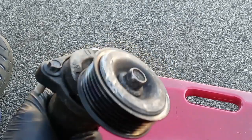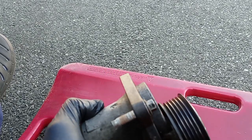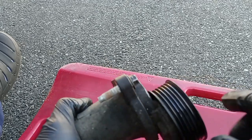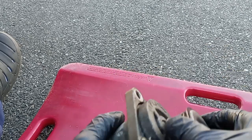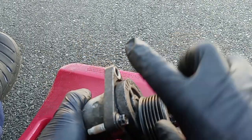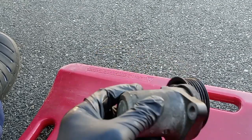When I was driving, I heard a noise and I saw smoke, so I pulled over and realized the tensioner was the problem — it wasn't spinning. Anytime you hear a noise like that, look out for the tensioner. It's supposed to be tight and spinning; right now this one is not spinning, so I gotta change it out.